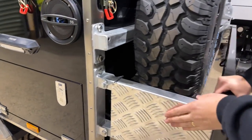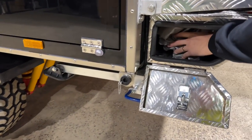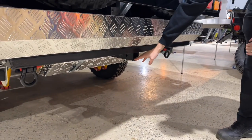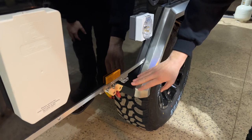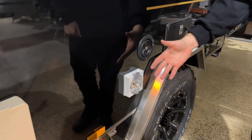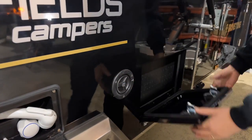Just at the rear of the camper — if you ever need to change the tyres, we've got two clips either side, so you remove them and the tailgate panel just drops down so you can get access to the tyres. We've got the rear pole lock — these poles are all for internally in the camper and window poles. Your awning is all air. We've got two 4x4 recovery points and one bike rack mount. Here we've got the vent for hot water — we'll talk about that a little bit later. We've got outlets for your hot and cold water. This Anderson plug is for a solar charging line — you use your solar panel when charging. You've got your 15 amp inlet — you plug this in and it charges your batteries and points throughout the camper.